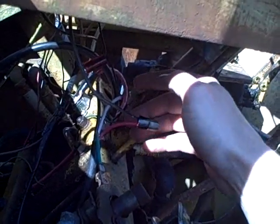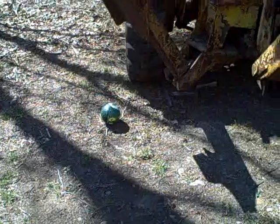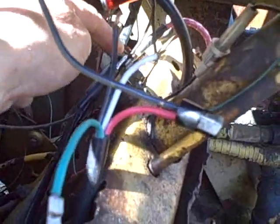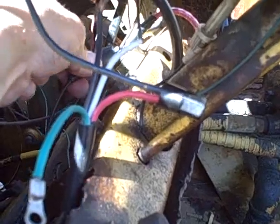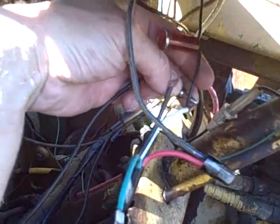The light's not going out. But let's see what happens if we touch the field wire. Of course you can't hear a word I'm saying when it's running, but what I want to do now is pulse that field wire connection with 12 volts to see if it starts charging. I'm on the circuit breaker because I know I can pick up 12 volts there — that's where I found my bad connection. My idiot light's on. So when I put 12 volts here, it should go out — and you'll notice it's staying out because now it's charging.